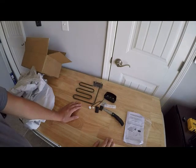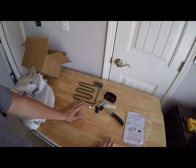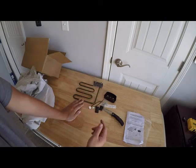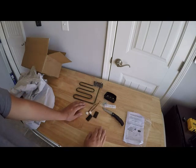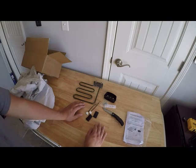The removal process is going to be pretty straightforward. What we're going to do is take off all of the attaching hardware on the element that's installed. Then we will remove the heating element and reinstall this new one. Put the rubber gaskets on, attach our leads, put some heat shrink over top of the leads to keep them extra protected. Then do a test to make sure everything works out.